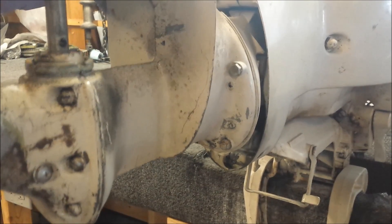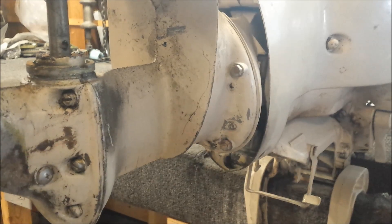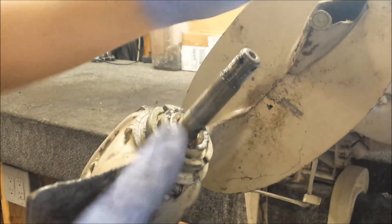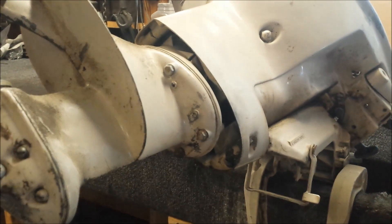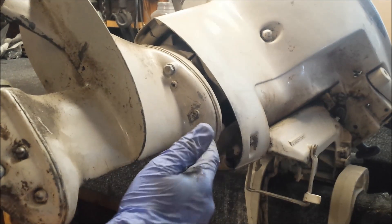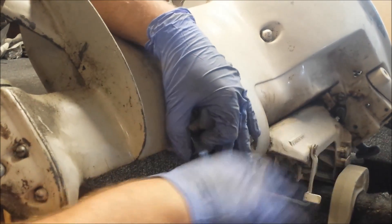I have the motor tilted all the way up. What I like to do first is pull the lower unit off. To do that, there's a bolt here and two on the other side - can't really see them but I'll get them off there. For some reason it's got a smaller bolt here than it does here; this one's a 3/8ths, the top is a 7/16ths.